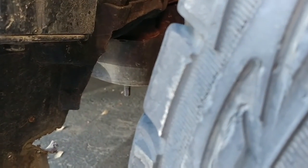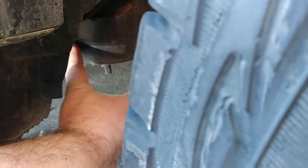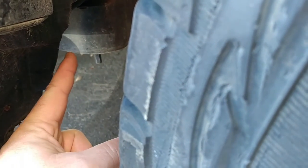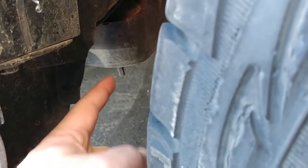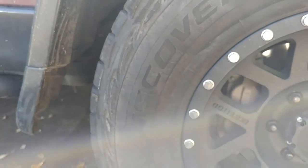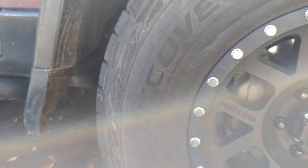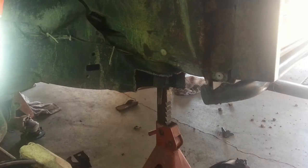Here's the first welding job I had done on this truck — a body mount chop. This thing usually sticks out over to here, and with oversized tires it rubs up against it. So I wanted to put bigger tires on it. These are 33s, stock was 32s. I wasn't ready for a lift but I wanted to fit the bigger tires, so I had the body mount chop done. That allows me to run the bigger tires without rubbing on the body mount.